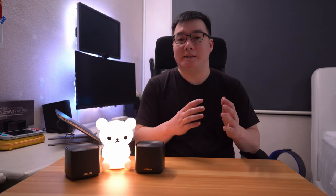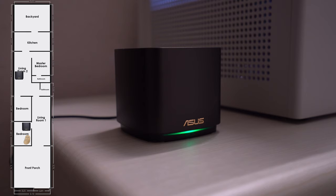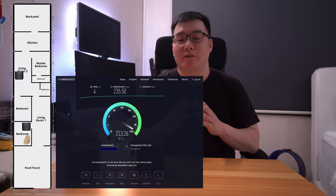In that first test, my MacBook was already struggling to connect directly to the main router in the living room. But I also wondered — what if I had put the second AP in my room? Would that AP also struggle to communicate back to its parent node? I hooked it up beside my PC and did another test, and numbers were actually at a very usable 235Mbps. The radio hardware in these units is definitely far superior to client devices. Of course, this wasn't enough to satisfy my curiosity — I had to find out how far you could potentially go.